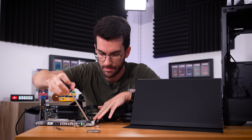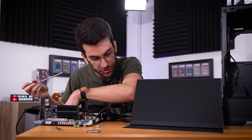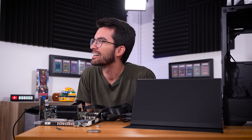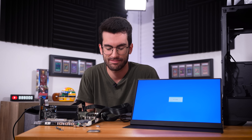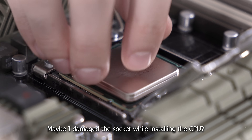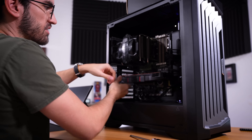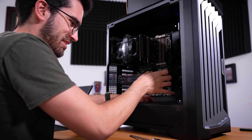I also don't have a cooler atop the CPU — we're not going to leave it on long enough for that to even matter. I just want to see if we can get a sign of life. The chip's getting hot fast, which is good — that means it's getting power. LED over the graphics card... that works! There's no way! I cannot believe I sabotaged the build. I did not think it was something I did. I'm shocked. I suppose from one angle I'm really not shocked — I've done worse before — but man, I can't believe I trashed the socket. I'm just going to go full beans here, reinstall everything that was originally intended to go in this system, including the 24 gigs of DDR3.